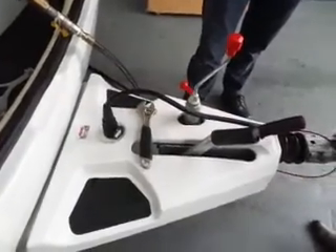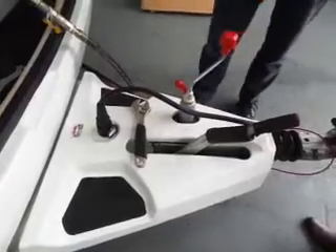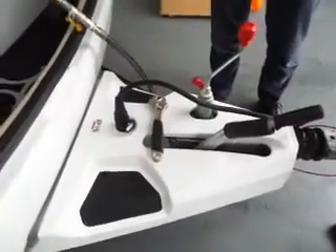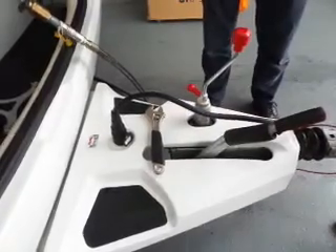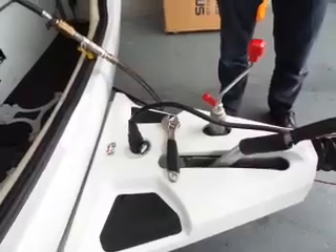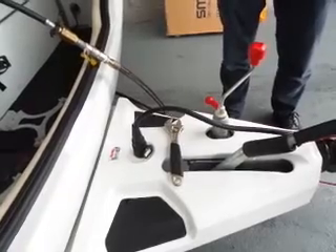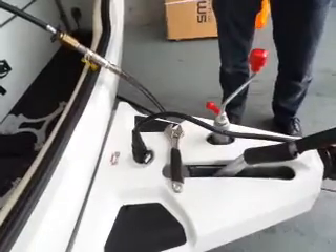If it's a flashing red light, that means there's a fault — you can try and reset it by putting the electrics out and putting it back in again. The thing with that one is it may have applied the brakes. If you're aware of what the system does, all it does is apply the brakes to stabilize the vehicle if it starts going out of sync. If the brakes have been applied, you're not going to be able to move it.